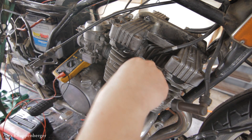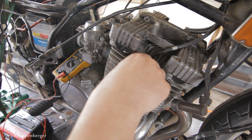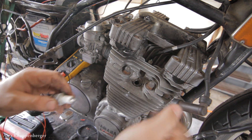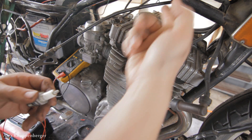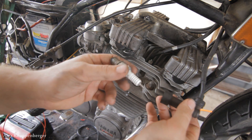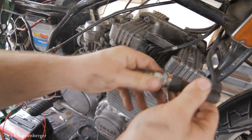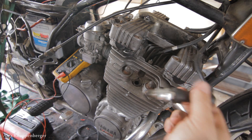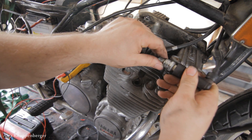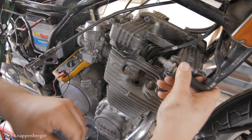Let's get this spark plug out here. We've got two coils here, so if we want to check both of them we could check for spark on one of the middle ones too, since that's the way they work — one coil does each outside cylinder, another does the two middles on this four-cylinder. So once we have our spark plug out, we're going to go ahead and plug it back into a wire on the end here.